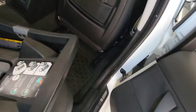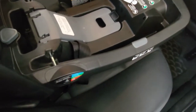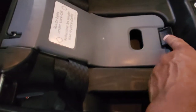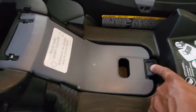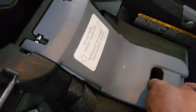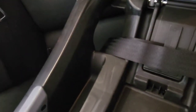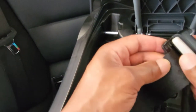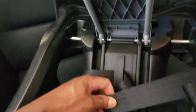For this video I'm wearing a camera so you can see exactly what I'm doing hands-on. Now, for this first part of the base, we're going to push this center plastic button to disengage the route belts that are locked underneath. Lift this tab up and now we have access to the belt itself. You're also going to want to loosen the belt as much as possible — grab this grey button on the side, press on it, and loosen it to get all the slack off.